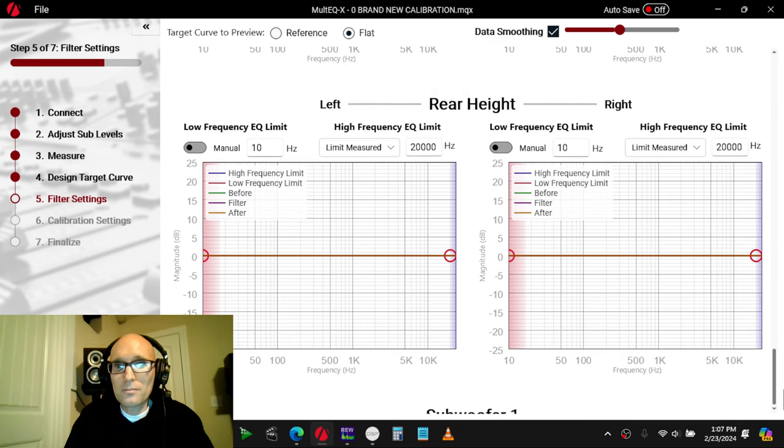So we were a little short of our target of 2 dB. This is why I set my receiver to 0.2. So just one sec. Let's fix that. I'm negative 10 right now on the receiver. A 0.2 difference is going to make nothing in the grand scheme of things with clipping. At least I don't think it would. So this difference that I need, I'm just under.